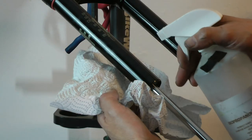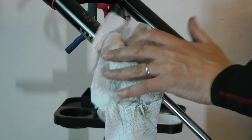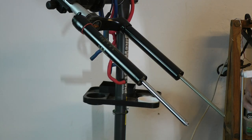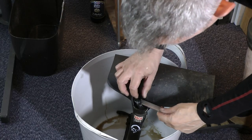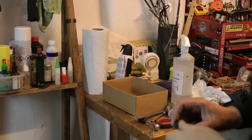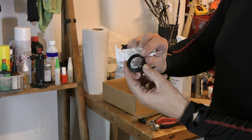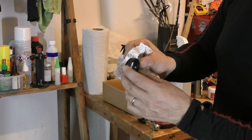Well, considering these are looking as good as I had hoped. I think my continuous bathing of the oil seals has done the trick over the years. I can't see any marks on those stanchions at all — very pleased with those. The bushes are looking pretty good too. Now to remove those seals. Let's see what this one looks like after a good number of years. It's still supple, there's still a nice sharp edge on the seal lip, and it wasn't overly mucky. Oiling the seals on every ride has done the trick — it's kept the dirt out.